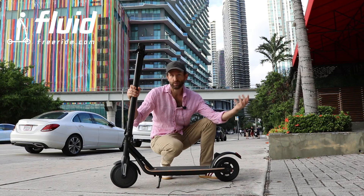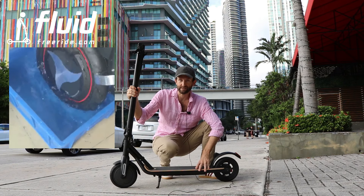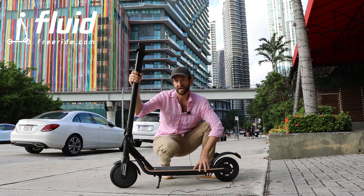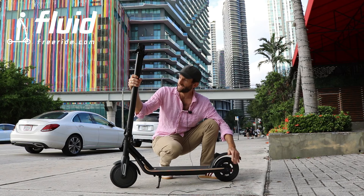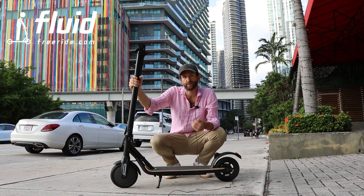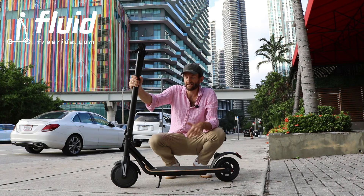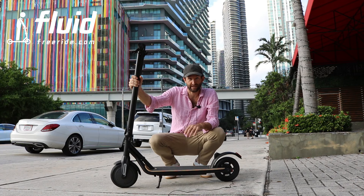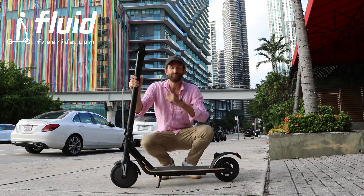One additional feature about this scooter, and this is important for daily commuter use, is it's IP54 water-resistant. That means you can use it in light rain, and I'll show in a little video box while I'm speaking how the manufacturer actually tested this by submerging the front wheel into a water puddle without damaging any of the electronics. So it's pretty waterproof, as expected for a little all-round commuter scooter like this. Then it has two gears. The first gear limits it at 10 miles per hour, but it feels like an electric limiting. The second gear is fully open and it goes until 18 to 20 miles per hour. The display is only in kilometers per hour for now, and it's impossible to show it in miles per hour, but in the next iteration of this scooter we're going to have proper miles per hour. The current scooter, if you're buying right now, it's only kilometers per hour.